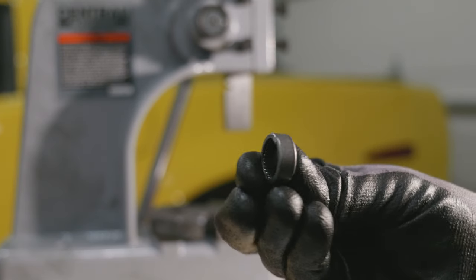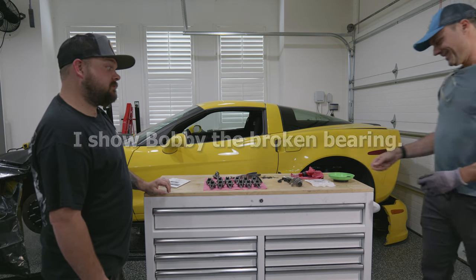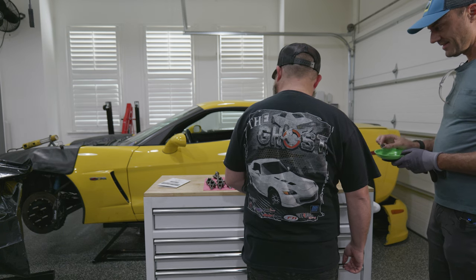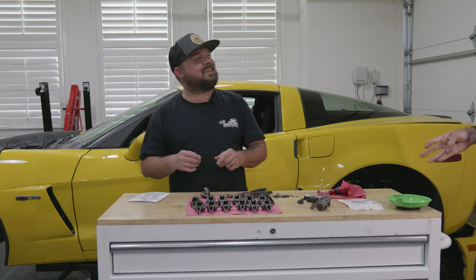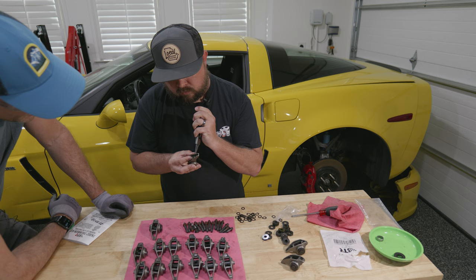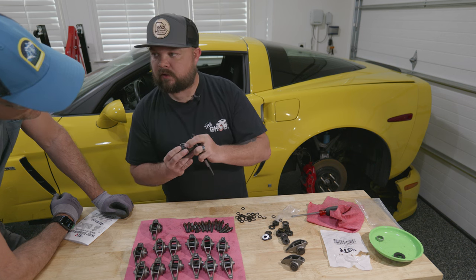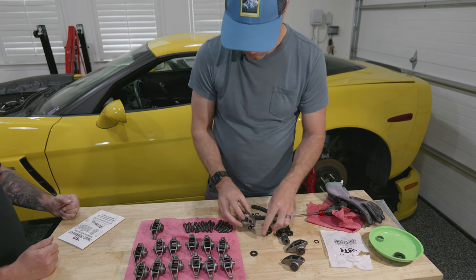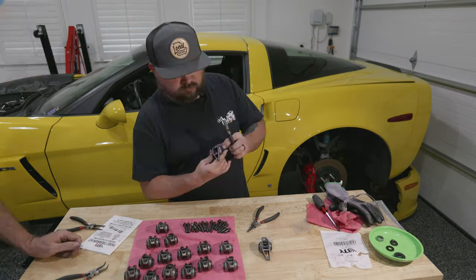This created a wonderful opportunity to play a little prank on Bobby when he showed up to help later. We got a little bit of a problem. You blew one out. They don't send any extras. Because we got the captive washers, how would you feel about we just shove this sucker back in there, squeeze that down? No. I think the litmus test of a good prank is if your subject is laughing at the end, so mission accomplished. The last step with this trunnion upgrade is also the worst — it's installing snap rings on the washers that contain the bearings. Bobby is good at it and I absolutely suck. I insisted on installing the snap rings myself until I ruined two of them and we were in danger of not being able to finish, then Dr. Bobby had to step in. And we got it done.